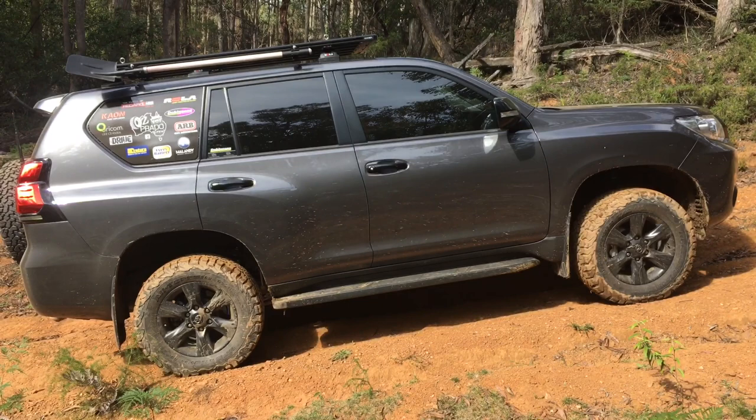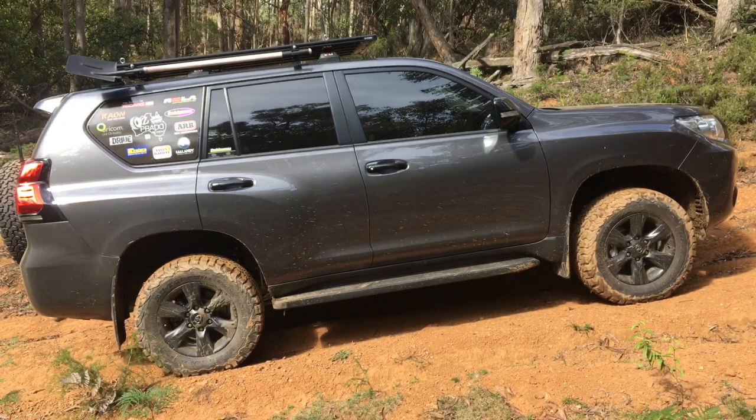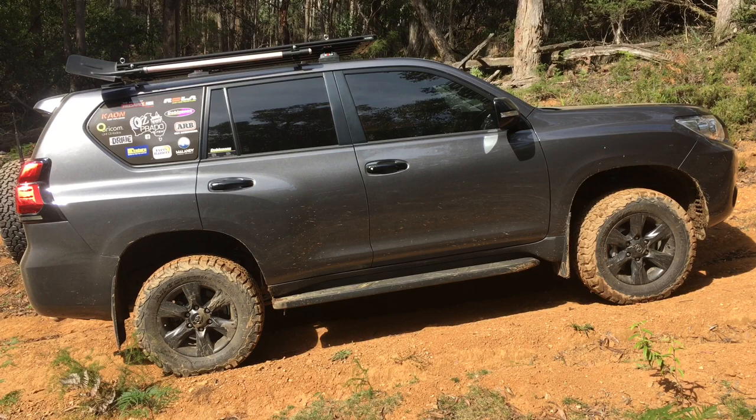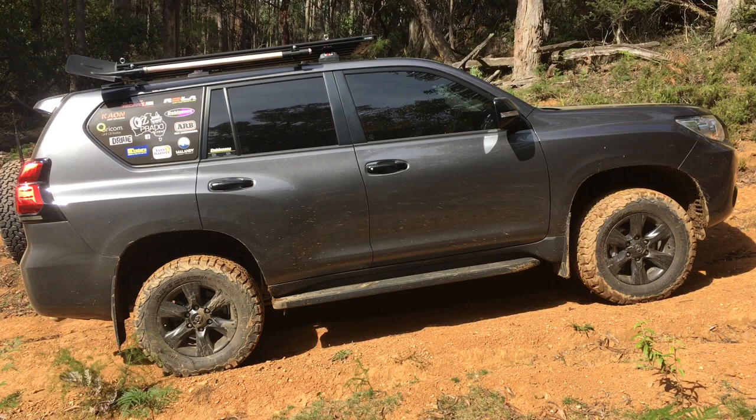The 327s in the back - just about every Prado takes those. There's nothing wrong with the comfort of the 327s or any of the rear shockers in the Dobinson's range, unless you've got MRAs with everything wound up too tight - the handling could be terrible. It can go really wrong if you don't know what you're doing. I'll tell you straight - it can be dangerous if you don't know how to adjust suspension. Just get your standard monotubes or twin tubes or combination, not adjustable.